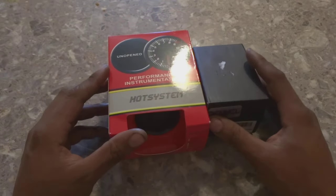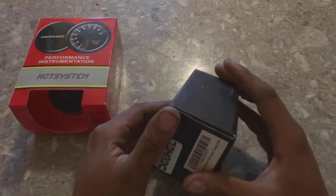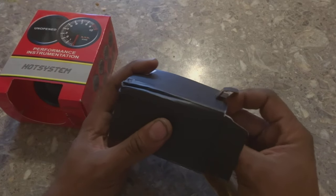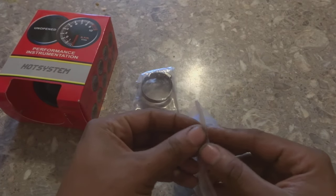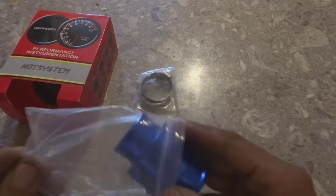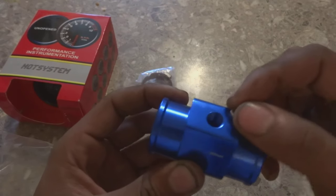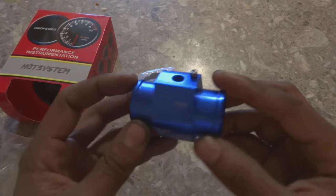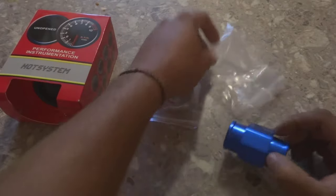From the Ford Explorer 2000, we're gonna need a gauge that comes with a sensor, and then we're going to need this pipe that comes with the proper hole size and clamps to hook up the sensor, because we're going to be putting this in one of the coolant lines instead of putting it in the manifold. There is a hole there that you put the sensor in — this is for your ground, so you put your ground wire on that. Hopefully I got the right size; this looks a bit small but it should work. These are the clamps that are used to hold it down.